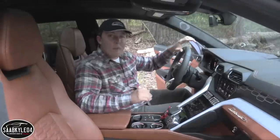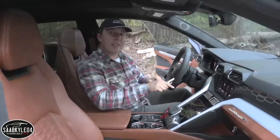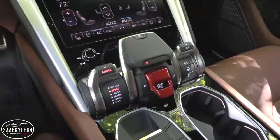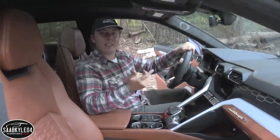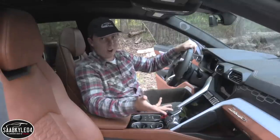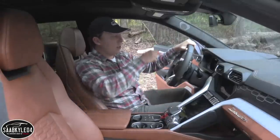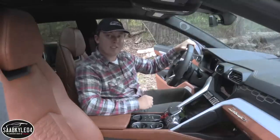There's so many things that I want to talk to you guys about in this video, but before we dive in, between the active exhaust system and the various drive modes, you can actually do a loud startup. What that means is that if you turn it off and put it back into accessory power and switch it into either Sport or Corsa, then start it, you actually get a much more aggressive sounding exhaust note. So let's go ahead and start it up in Sport mode, followed by Corsa, and you can hear the difference.